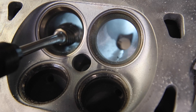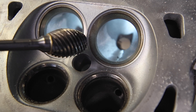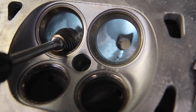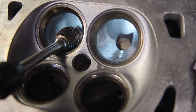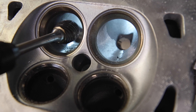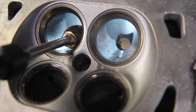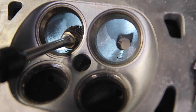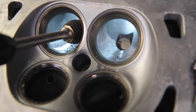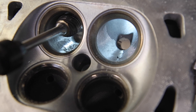Quick overview of what you've just seen: I'm porting just the bowl area here. This is just roughing out, so I'm using the Head Games Honey Badger burr — the baddest burr that takes out material very, very quickly. We're not measuring yet, just roughing out to get the shape. We use this one because it's the biggest one we can stick in there. When you use a smaller burr, you're shaping the whole time, whereas this one is already kind of making the shape.